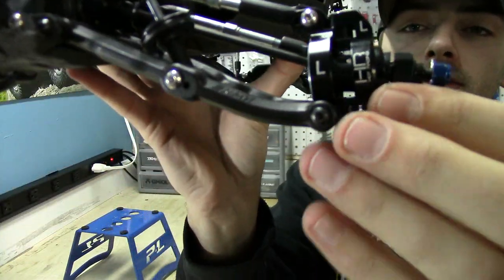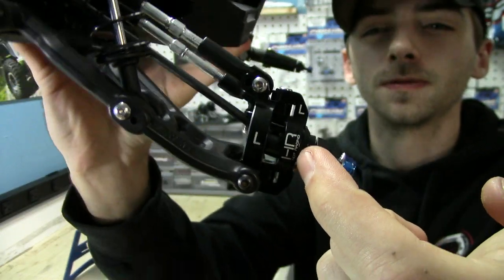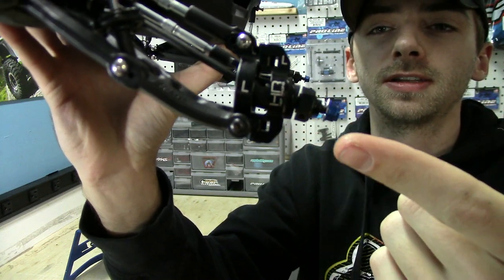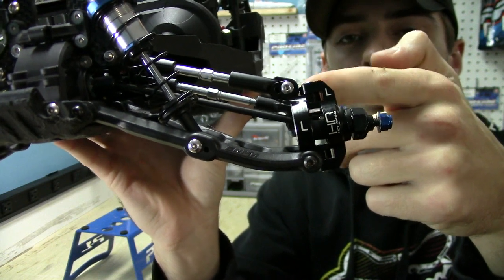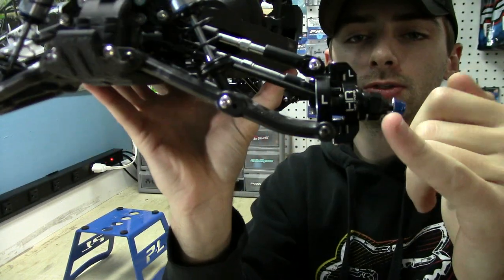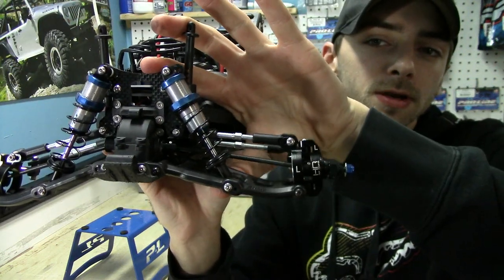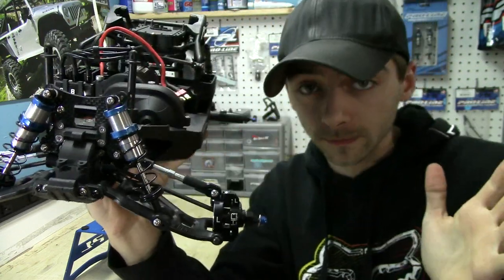Take a look — there is an angle to that. So if it's straight up and down, the axle actually comes down in a downward position, so you will need to adjust the whole knuckle and carrier inwards more. But that's fine because when the truck is level, so is the drive shaft. For the most part your drive shaft is going to be riding more up here than all the way down.